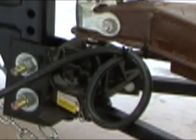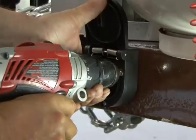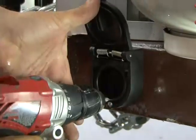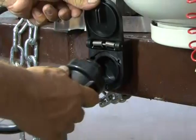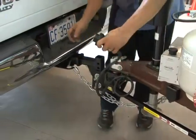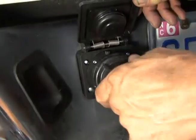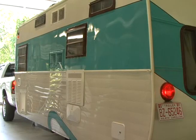Mount the electrical cable in a location as high as possible under the vehicle and secure with zip tie straps. With the trailer cable installed, mount the plug holder in a high location on the trailer frame. Choose a location that will be within easy reach yet not susceptible to being submerged in water. This holder has air venting holes and is not watertight. To insert the plug into the vehicle socket, remove the plug from the mounted holder pulling it straight out. Insert the plug into the socket on the vehicle and rotate it until the alignment index lines up for the connection. Check the operation of all lights and accessories before moving the vehicle.